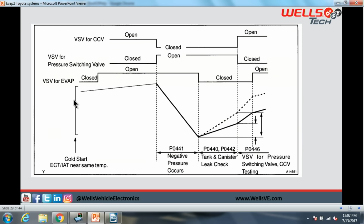So that's telling me that our pressure generation in here, we are measuring inside of our fuel tank right now. So our fuel tank pressure should increase because the fuel pump's running. We're going down the road, the exhaust is warm. We should build pressure inside of the tank, no matter if we're purging or not, okay?